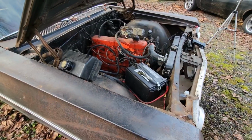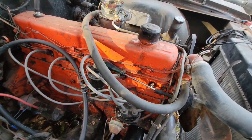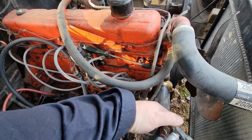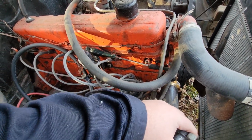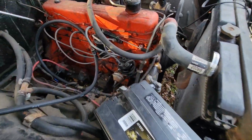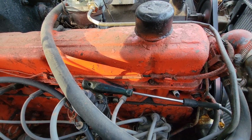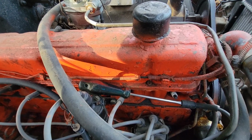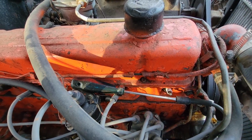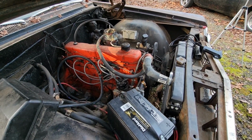See how that works. All right, still didn't fire up, and I forgot to record it, but no change. So same old story. Let's see if we got a spark up here now. Starting to lean away from the spark issue, guys. I'm thinking it might be fuel, but let's see what's up. Where's my key? Oh, there it is. Oh, we'll get it, guys. Should be better at this. We got spark there. Yep, leaning towards fuel now. Probably should have thought of that in the first place.